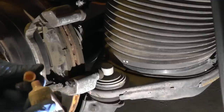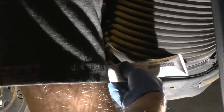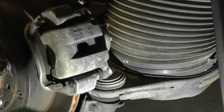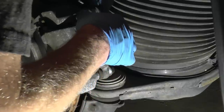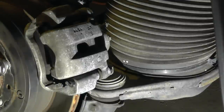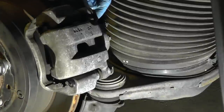Replace them and put the new ones in. Now the new pads are in — I'll zoom in so you can see. Take the caliper and squeeze it into the top bracket, then squeeze it inside. Tighten the bolts — make sure you don't over-tighten, just get them tight enough. And that's it — very easy and simple to do. Thanks for watching, hope you find it useful.